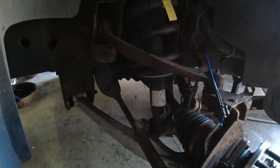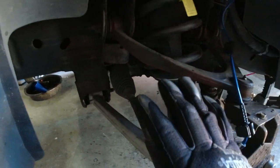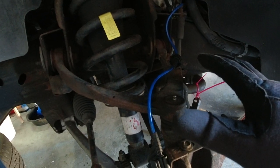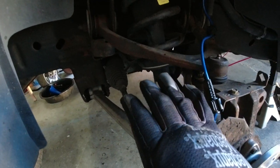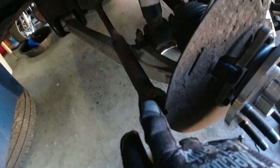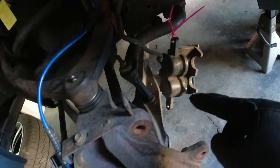All right, little control arm in, hub in, spring strut in, axle in, harness hooked up. All nuts have been ugga-dugga down on level one on my M18 mid-torque. I greased up the tie rod end. I greased up the upper control arm. I greased up the lower control arm. Sway bar end link in.